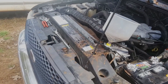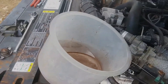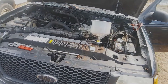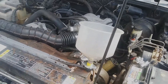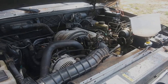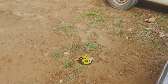This is this kid's first car, so we'll see what he and his parents want to do about it. When you have a serious head gasket leak, what will happen most often is you'll get no bubbles for a couple of minutes, and then all of a sudden you'll get huge bubbles. It'll suck down a ton of coolant and then boil back up and overflow — you won't be able to keep track of the coolant level at all. It happens a lot on Chryslers. As far as head gasket leaks go, this one's pretty manageable.